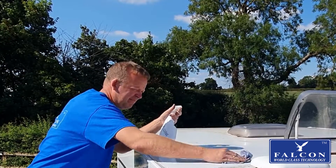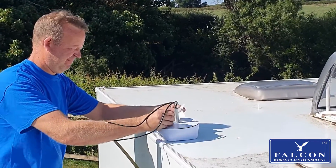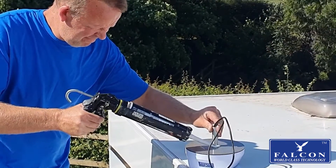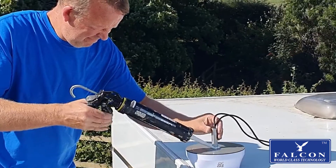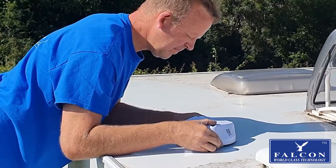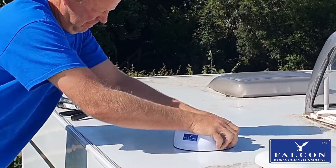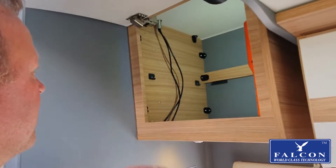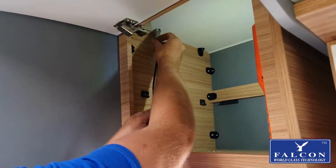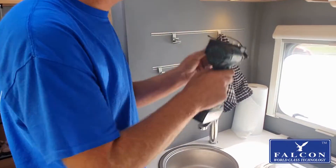To prepare for the installation of the 5G antenna, apply a generous amount of Sikaflex to the neck of the thread to prevent any water from getting in. Feed the cable into the hole, applying moderate pressure to get the 3M tape to stick to the roof. Pass the nut through the cables and thread until it reaches the ceiling — tightening by hand will be strong enough.